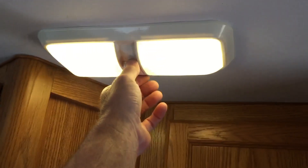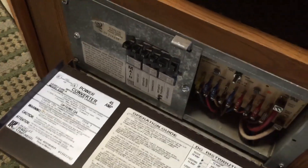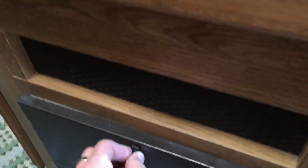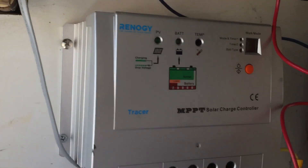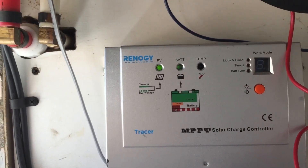Come inside, check the lights, make sure that my propane detector is working and all the other little things here. The main is on — I always keep my converter off because I've got the inverter hooked up to my shore power. It keeps all my AC circuits inside the camper hot when I turn on my inverter. I can flip it on just to make sure everything is working. Inverter power is up. Make sure that everything is working properly on the charge controller.